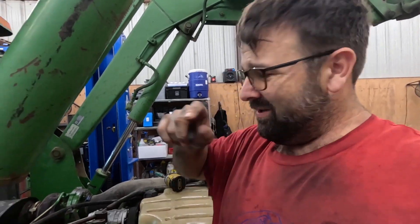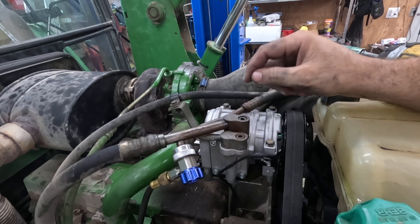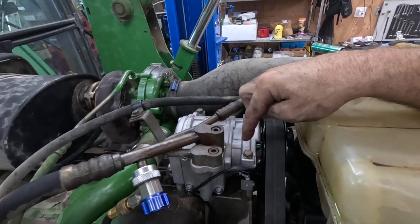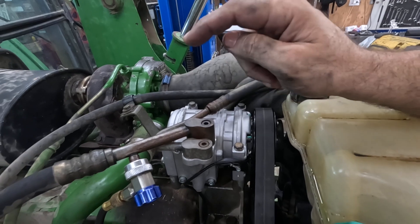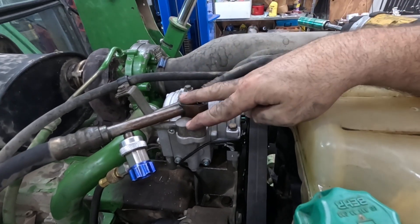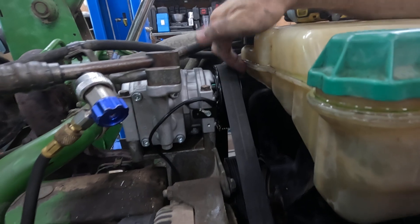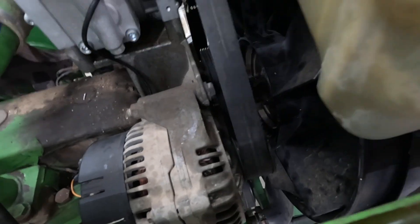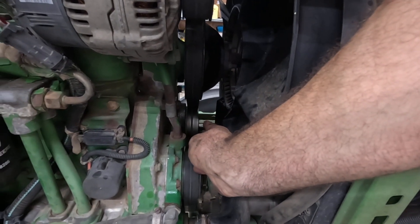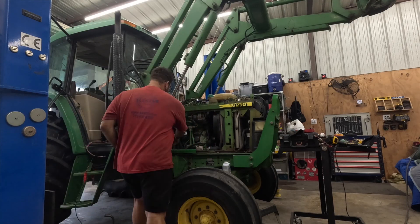After a bolt on the top of the hose broke, I had to drill it out and go track one down — that took me a couple of hours. After we got that taken care of, we got the new compressor back in with all four bolts — 13 millimeters — and a 6 millimeter hex for the hose fittings; this one's 40 millimeters long and I think this one's 25. We blew out the lines, used the flush as already mentioned, and put the belt back on. Because the coolant tank is in the way, I took the belt off down at the alternator, put it on up top, and then with a wrench moved the tensioner pulley up to loosen the belt and hooked it on top of the alternator.